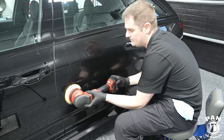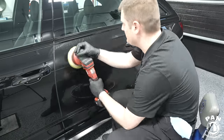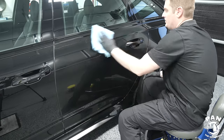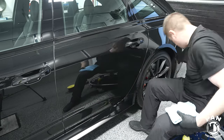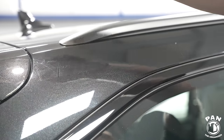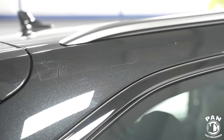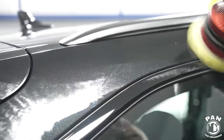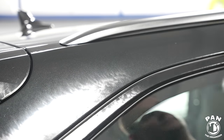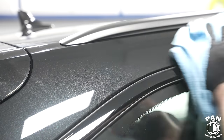For polishing, I used the DIY Detail Gold Standard Polish — it's in spray form. I used their Gold Waffle Pad for the finishing polish. It's a hybrid polish: with a more aggressive pad like their wool pad it can act as a compound, or as a finishing polish with a soft foam pad. There was some residue left over that the tar remover wasn't fully removing — that's from the tape job from the manufacturer. A cool feature of this polish: you don't even have to tape up the trim. You can polish the trim too — it's not going to stain trim.